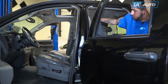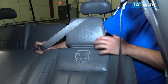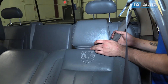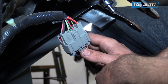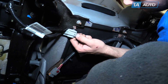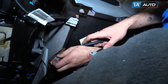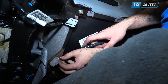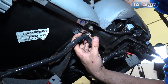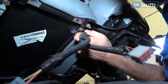Lay the seats back and secure the rear seat belt around the headrest. Buckle it in so you can work on the bottom side of the seats. Disconnect the electrical connector under the driver's seat. Disconnect the two electrical connectors on the passenger side of the center seat, pulling back on the red safety tab on the rear-most connector so you can push down and release it. Remove the wire loom retainer from the front driver's corner of the harness.